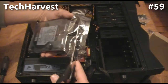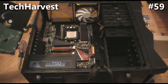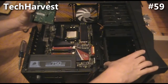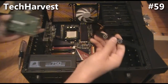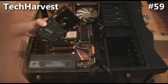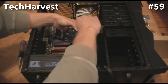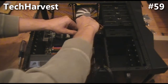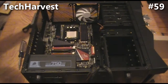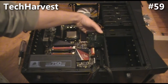I'm just going to cut it open here — make sure I'm grounded. Now there are seven bays for hard drives in this case. You can use the tool-less option where you put rails on the side, or you can actually mount it with screws. I trust mounting with screws better because the rails jiggle a little, and with a spinning plate inside, you don't want the hard drive to get off balance — that could really damage it. I want it solid in there.